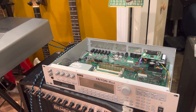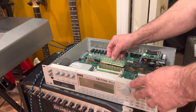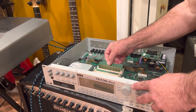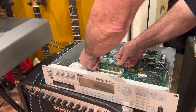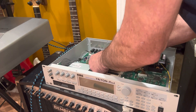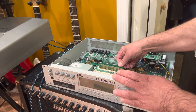I'm going to leave it in its place and let's go with the other 16 next to it, and then I'll put the 32. You want to do it with those proms pointed away from you. It's pretty easy to do, although my eyes are getting kind of crappy. You kind of go in at a slight angle and then snap it in place.